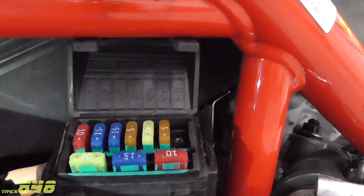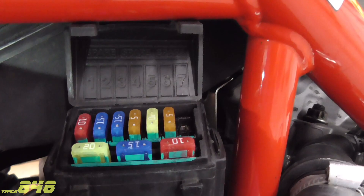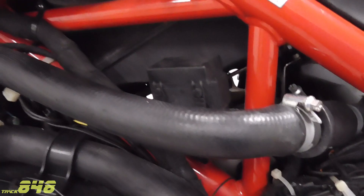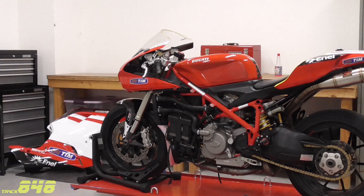Let's go ahead and replace the fuse, and it's very important that you use a new fuse with the same exact amperage as the one you took out. Check your owner's manual and look at the fuse you removed to confirm the amperage. These blades just slip in and you can push them in by hand — make sure they're nicely seated. Those are the main things I check before trying a new fuse. If we're lucky, this fuse just went bad due to vibration or age — this one's about eight years old — and hopefully the new fuse will take care of it. If it blows again, we'll have to keep searching.